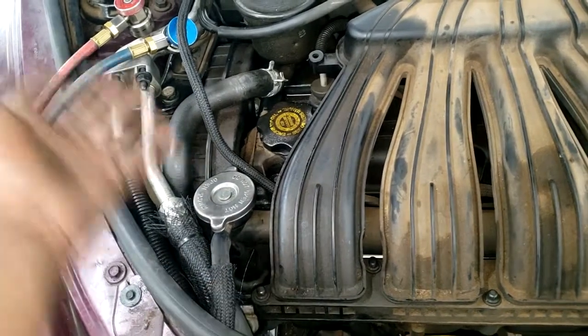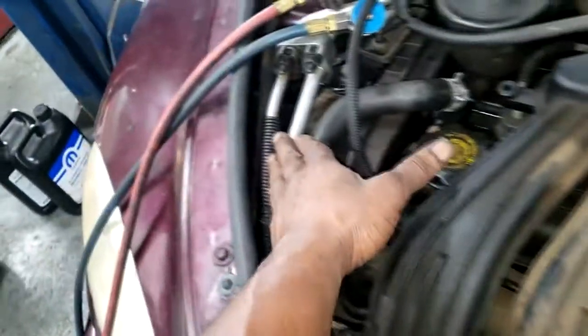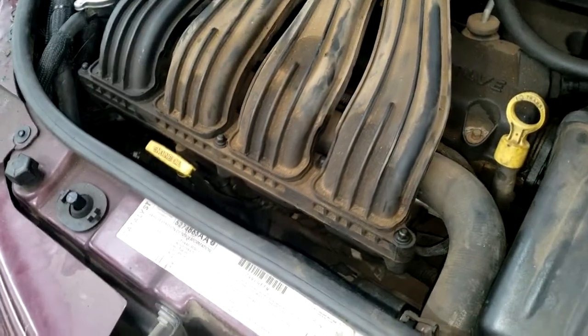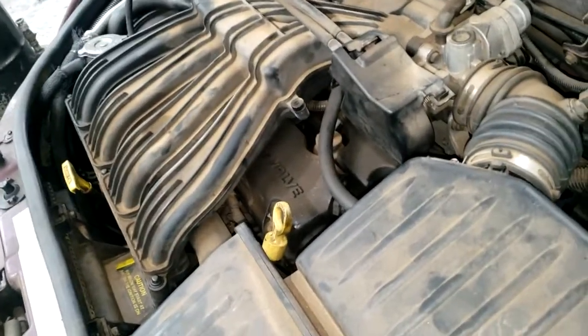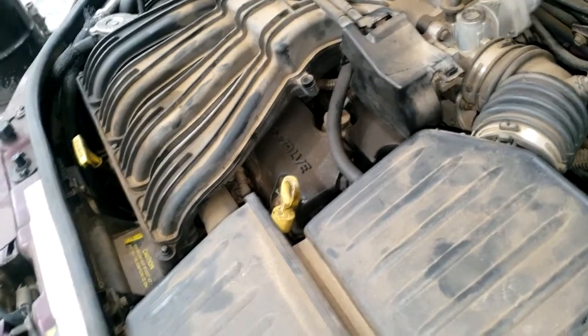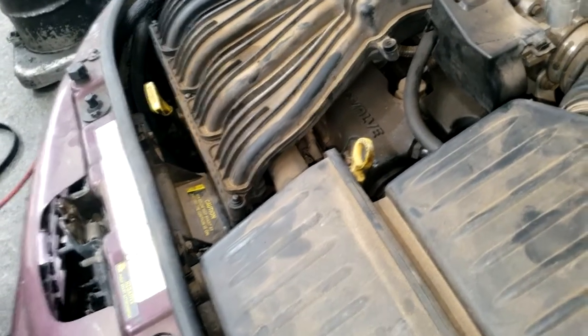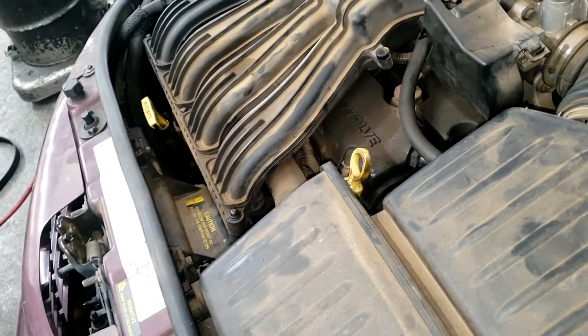I reinstalled the freon I reclaimed, only to find out: AC cold, lines freezing, but no fan operation. This will drive your high side pressure too high — you've got to have that fan blowing across the condenser to pull in air and lower that pressure. So I suggest anytime you've got a PT Cruiser in your stall for any problem, because this is a known problem — check the fan first. It doesn't matter what the complaint is.